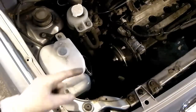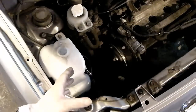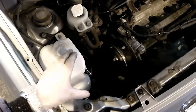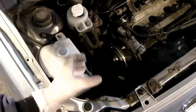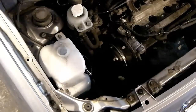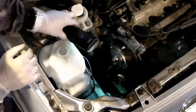So when you manually wind these through, as you should always do before you put a new belt on, tension it and start the car, when you manually wind these through using the crank pulley bolt, you should always turn it at least twice. In this case, I'm going to run it through several rotations just to make sure, because I want to be absolutely certain that this belt is lined up correctly, and that way if anything happens and I get contact manually, I'm less likely to do any damage and I can realign everything. I'll try that again without throwing the torch around.